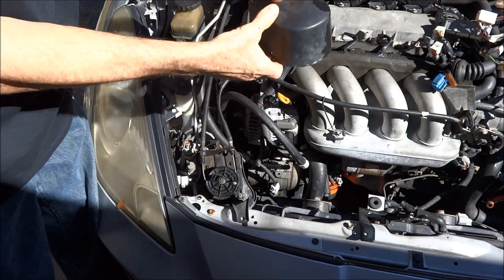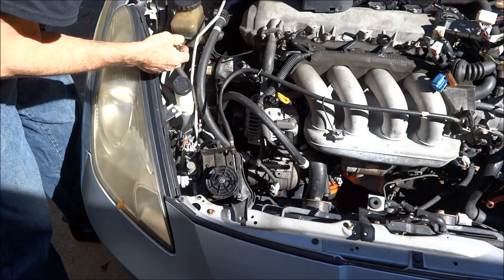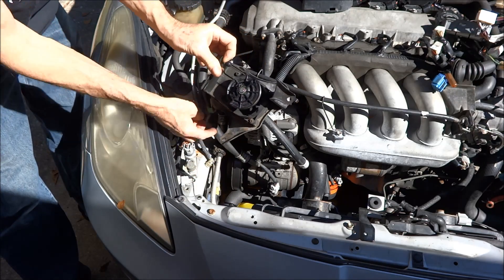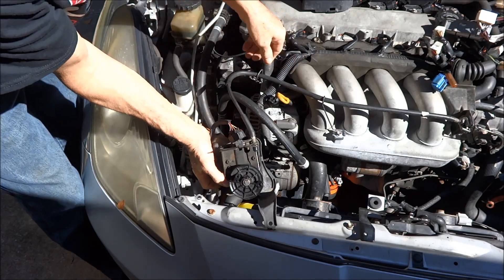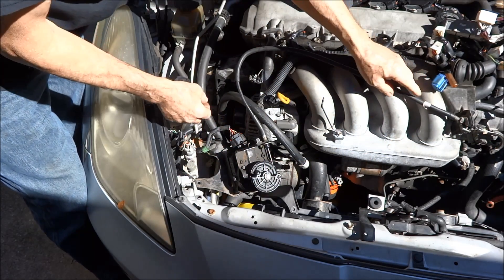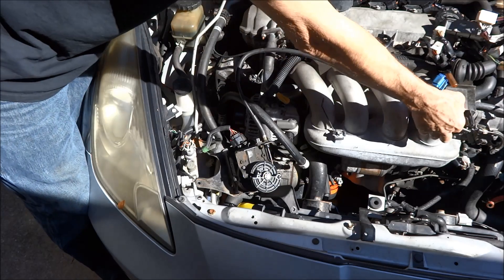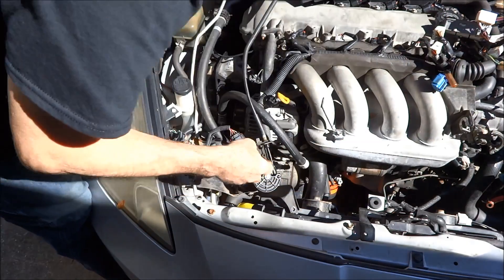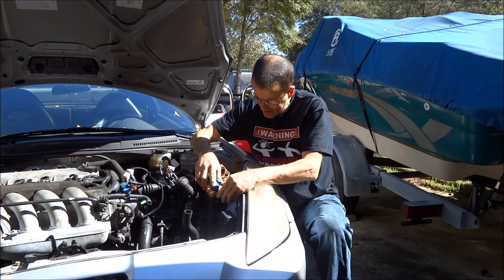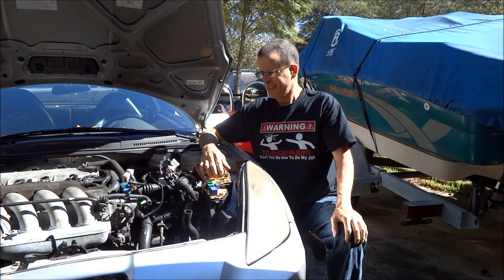Cruise control — two little latches, pop the cover off, loosen this nut, cable out, lay that back out of your way. Three bolts: two of them down in the bottom, one up front. I've already loosened this nut on the clamps. I try to loosen the back side of the nut on every one of these cables — that way I know it's going to need an adjustment when I put them back in. Before you go any further, lay these boxes back in place. You don't have to push them all the way down into the clips, because if you close the hood you're going to end up breaking a corner off one of these. Don't ask me how I know that.